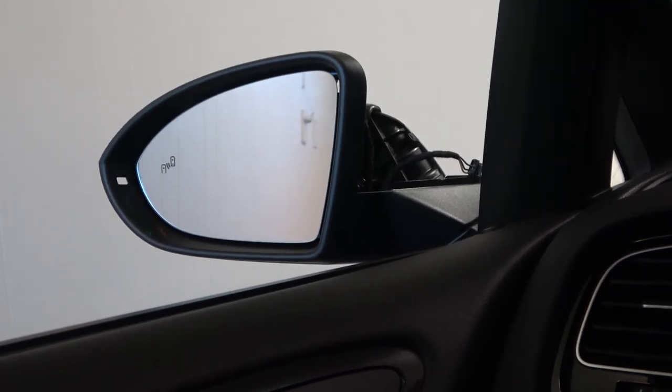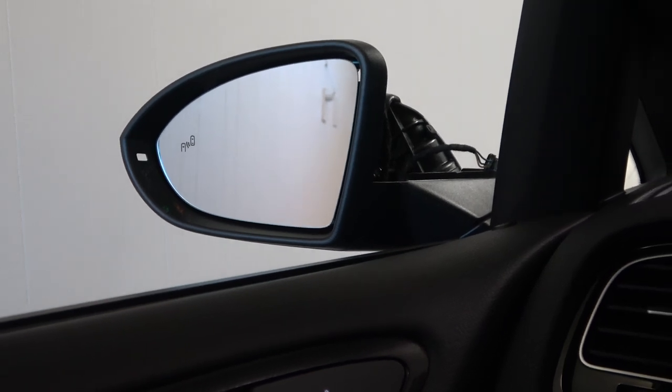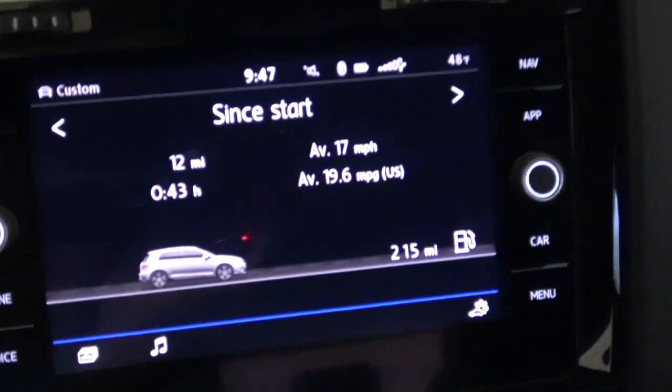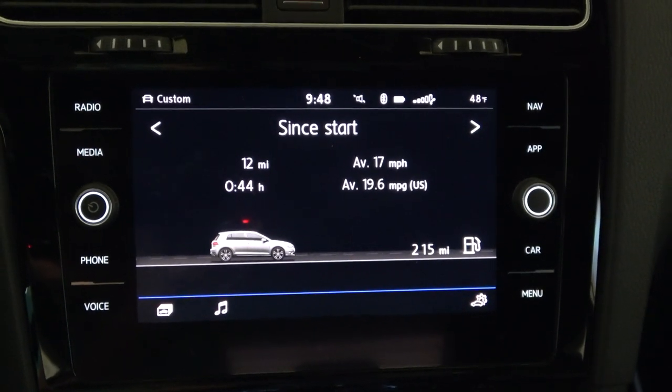There's one more to activate - actually three on each door module. The front field light is the puddle light that is part of the new mirror. The old mirror had no puddle lights but this one does. So you're going to take 'front field light' and make that active - that's going to activate the little puddle lights. When you unlock the car, it will light up those little lights underneath the mirror down to the ground. Now that we have that simple coding done to activate the folding mirrors, what will happen so far is that when we move the knob to the folding mirror position on the driver's side door control, the mirrors will fold in.